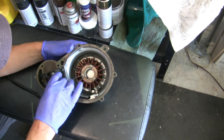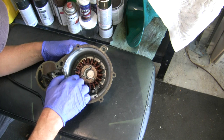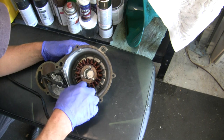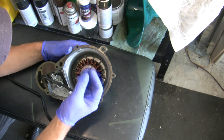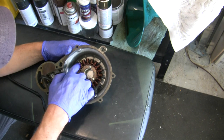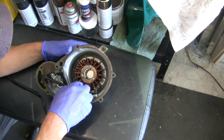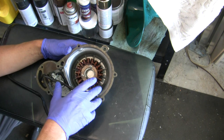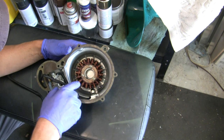This is a stator, and it's essentially the same as what is inside of the CX500, a little different. But you've got three circuits here — three big coils of copper wire with an insulating shellac around them. These wires are coated in the thinnest layer of insulation. There are three phases to this thing, and it generates AC current — alternating current — quite a bit, like up to 70 volts. That is enough, of course, to fry your battery, and AC doesn't work with a DC system and a DC battery.